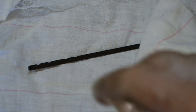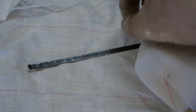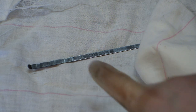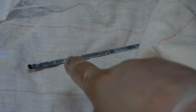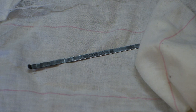That is the situation where there is no driving in this car, and the oil is in here. But when the motor is hot, we use a different scale, where there is a comment hot. The third dent is the low, and the upper one is the max and OK level. This oil level measurement is so complex in automatic transmission cars, because we have two scales for hot engine and cold engine. Be careful when you look at those amounts, because if we have too much oil in our automatic transmission, then we have troubles, and it can cause some issues.